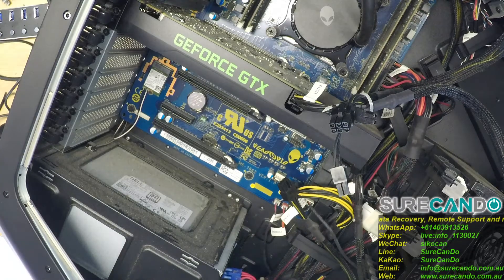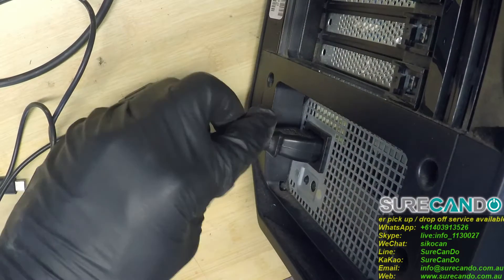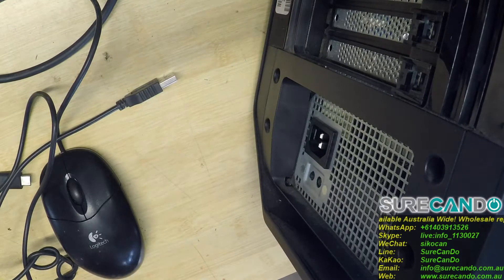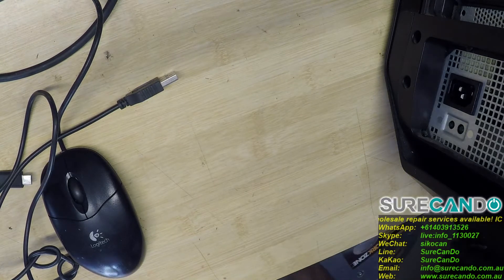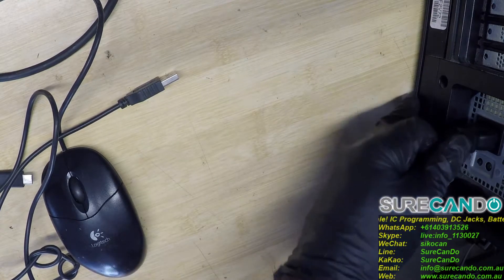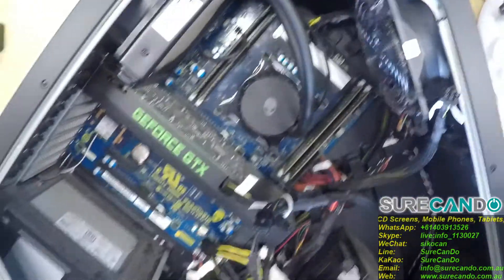Let's plug in the cable again. We've got nothing plugged in. Ideally you want to load the power supply most of the time, but I just want to see a green light come on. Let's see if we've got a green light. There's a different power cable — just to rule that out — in case it's a power cable problem. Something killed this power supply unfortunately, as it doesn't want to turn on.